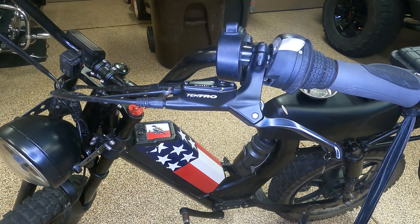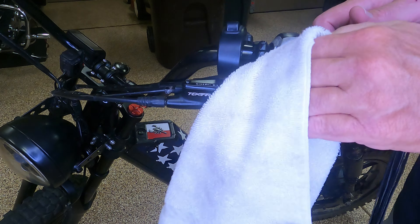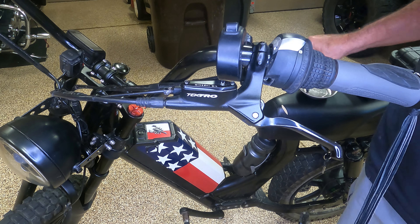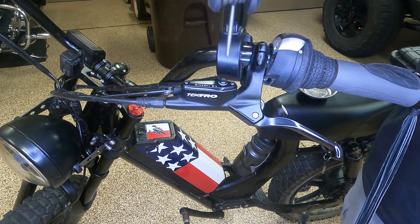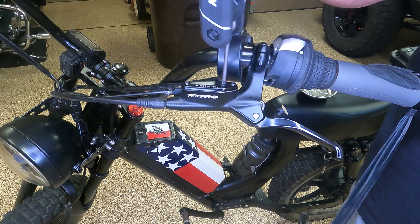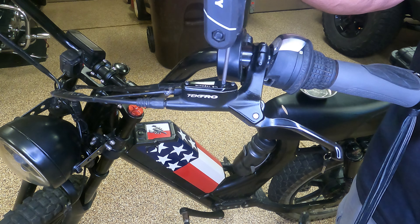From there, here's what I do: get your towel and wipe off the top. It's just mineral oil — and what is mineral oil? Mineral oil is baby oil. Now all you've got to do is put your plug back on. You're going to get a little overflow when this thing goes down and seats and seals. Get that tight — as we say, for those of you that speak German fluently like me, you want to make sure you get that gun tight.